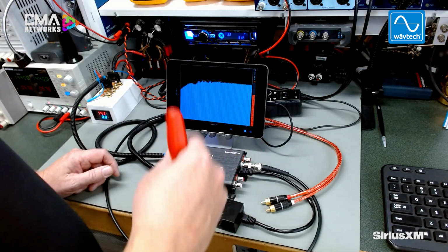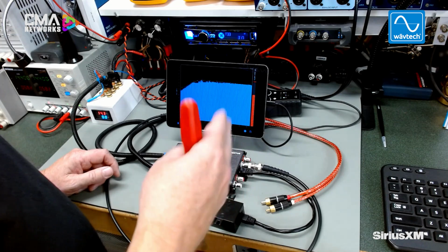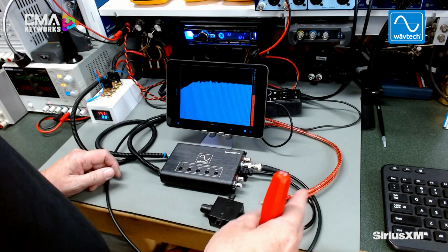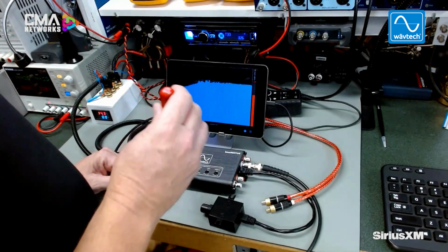Next thing is, almost all bass amplifiers have a low pass crossover. So set that approximately where you think it's going to be. A good place to start is 80 hertz. And then, once that's all set and the amplifier is set, we get to the bassRESTOR.